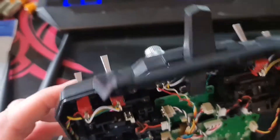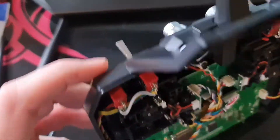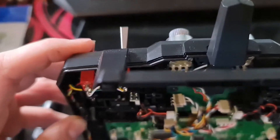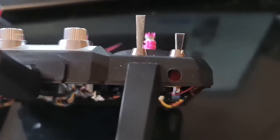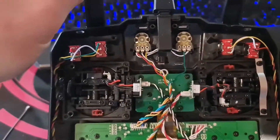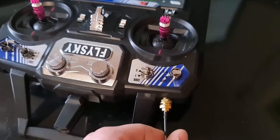Next I just need to find out where I'm going to put these new antennas. Best place is probably going to be up here, so we'll just drill a couple of holes on each side. A 6.5mm drill bit to drill these two holes — just be very careful of the switches underneath and the SMA should just fit in there nicely.